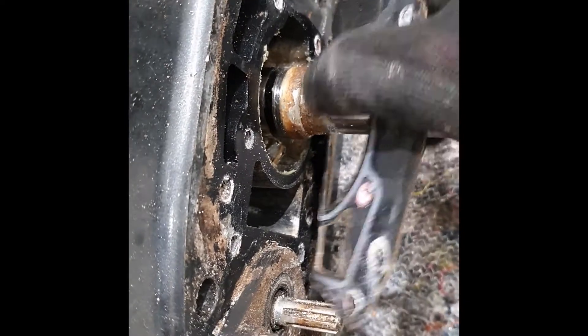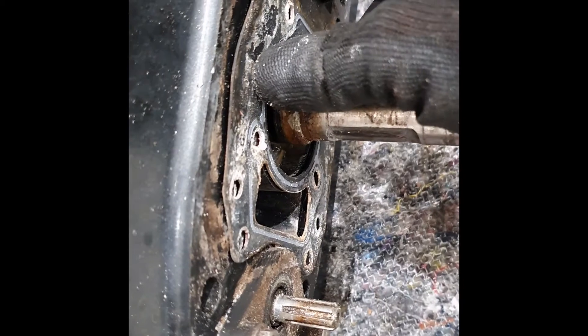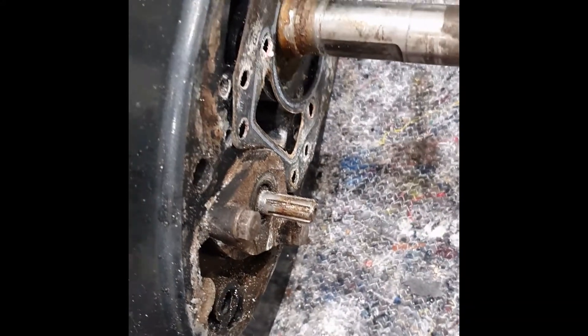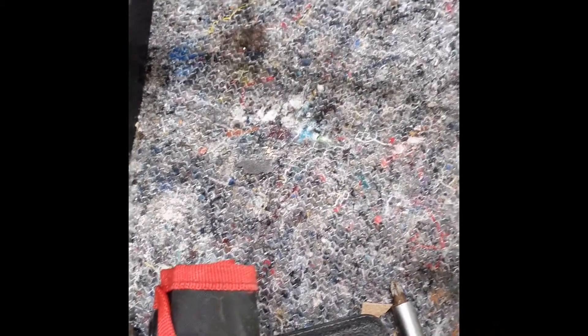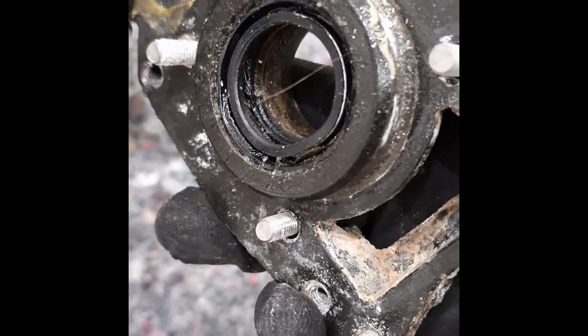So as well as this gasket here and the drive shaft gaskets which I'll be doing later with the propeller off, I will also replace this gasket on the bottom of the pump housing, given that it's now off and it's probably only a couple of pounds as a part. It's quite a common Mercury water pump, which should completely resolve any ingress problems into that gearbox.